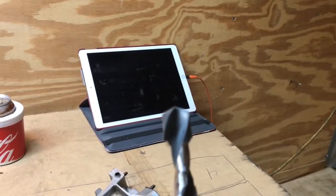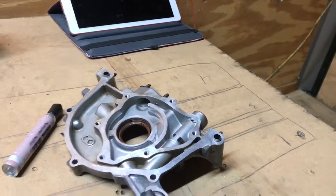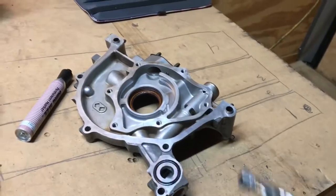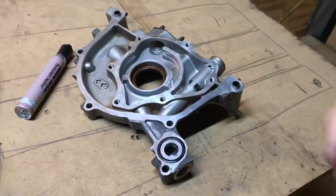I ground it down as far as I thought was suitable. As you can see, I've got quite a bit off. All I need is the tip. I'll lube it really good and then slowly go through there so it makes a nice clean cut. Then I'll go back in and do a fine finish on it so it's nice and polished.